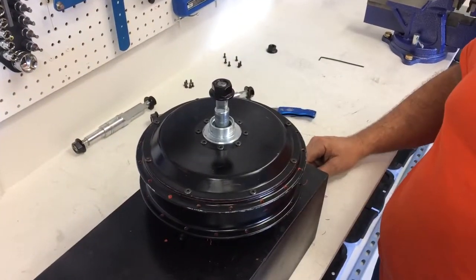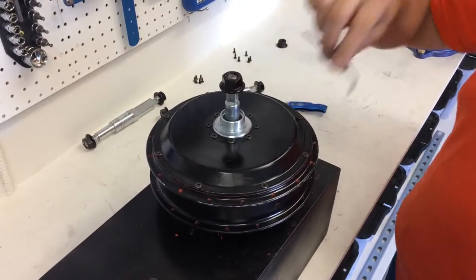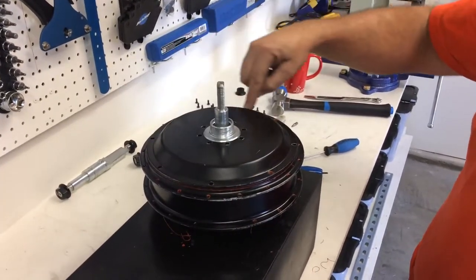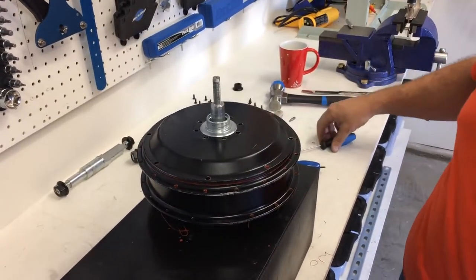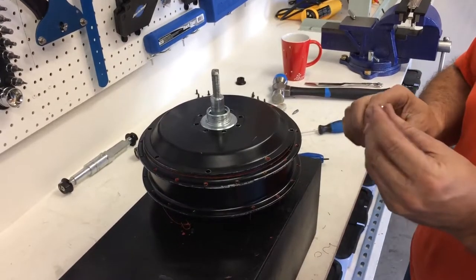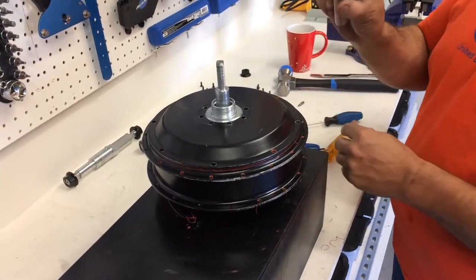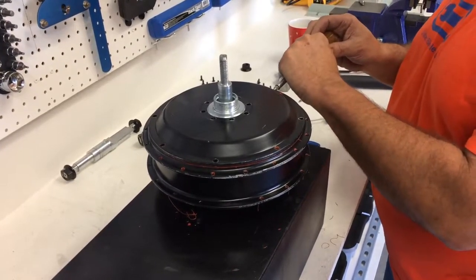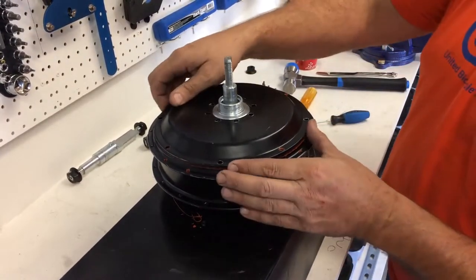So this is the other side. I'm going to do the same thing: use a 3mm hex key, go around, and take off the bolts. When I put this together, I used a high temperature silicone gasket, and it was kind of acting like glue, so we had to use different tools to get in there. We tried a small regular screwdriver and it was too big, then we found a thinner bit and were putting it in the crack, getting pretty frustrated. While I was in the house getting a really sharp knife, our cameraman put this right on the crack and hit it hard, and was able to defeat it. Once he got a little bit in there, we now have the cover free.